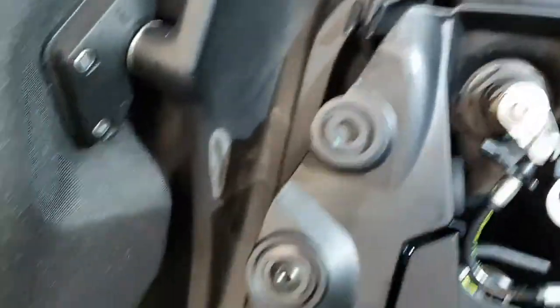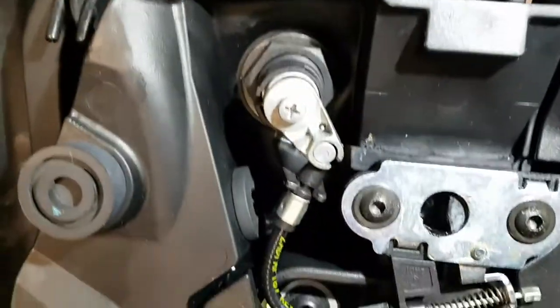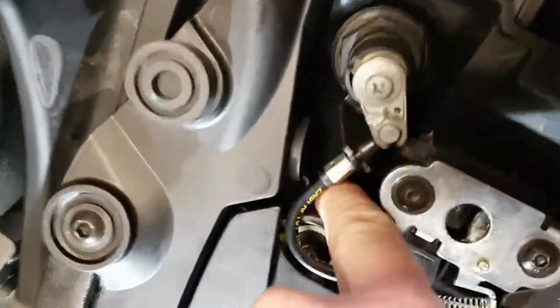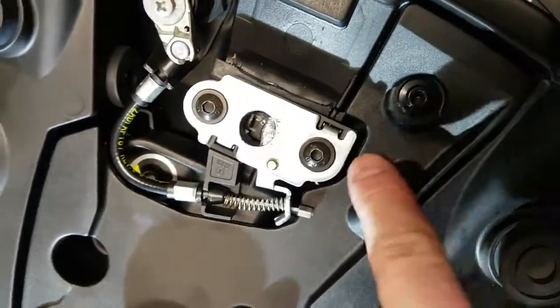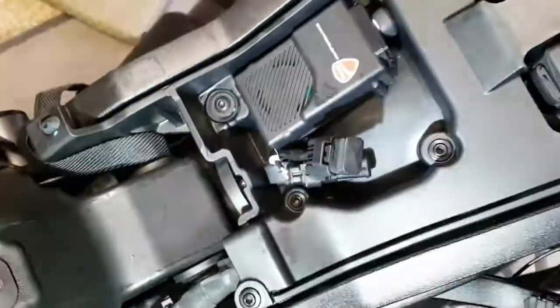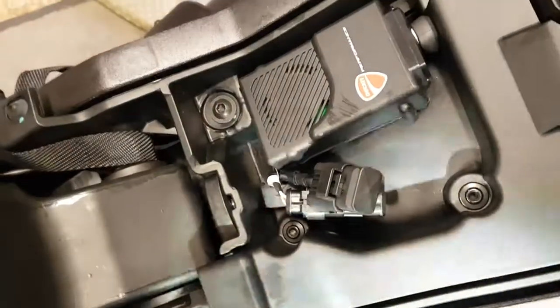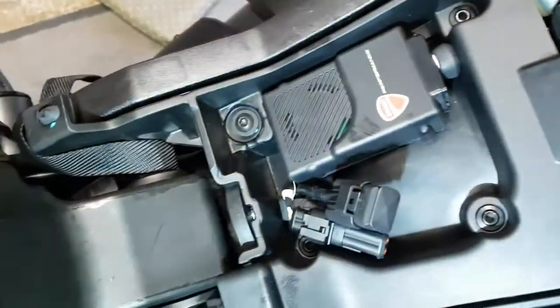There's various sections, but I wanted to point out something. If you are going to use the hose, it can get under the seat, and just down where I'm pointing, the water accumulates. Let me see if I can put this light down. Just down in here there's a little trap for water, and the other side as well, and you can find that water can actually trickle all the way down this under seat area. And in fact, what I do is make sure that the alarm and these sockets are wrapped up in plastic, and a cloth is in this area here to soak up any water that might get in there.